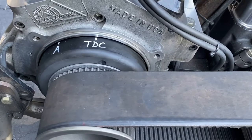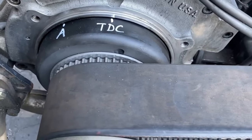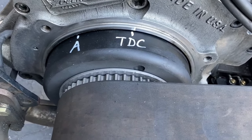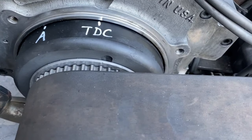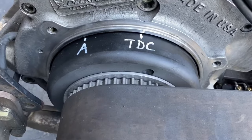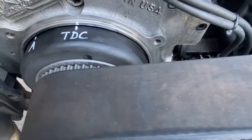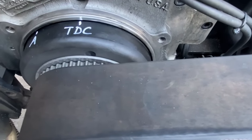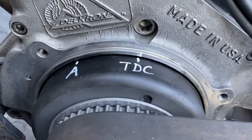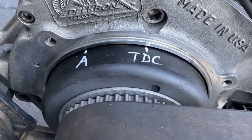For those of you with an open belt drive or enclosed belt drive, you can always find a way to mark it — this is how I did it. With a belt drive, an easy way to time your bike is to have the advance mark and a TDC mark right on the belt drive, so you don't have to open up the plug and make a mess with oil. You can just bring it up to 2,000 RPMs and you should be at the advance mark.